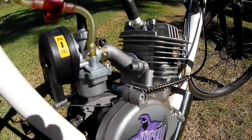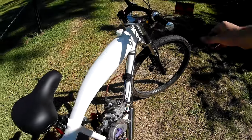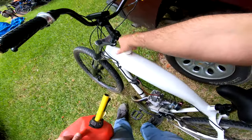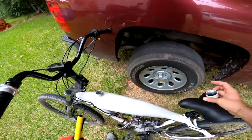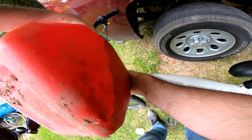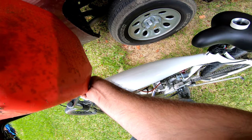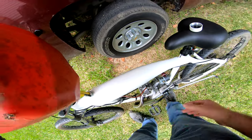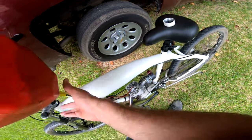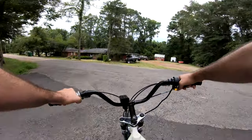One thing you should know before moving through the rest of the video is there are three different versions of the Phantom 85, or generations, whatever you want to call it, where they have minor tweaks to help solve issues which have been plaguing these motors since day one. The first generation used a bronze graphite-infused bushing for the connecting rod to the wrist pin. The second version replaced this with a brass bushing that was a bit stronger. And the third version, which is anything you've purchased in the last couple of months, has a proper needle bearing.